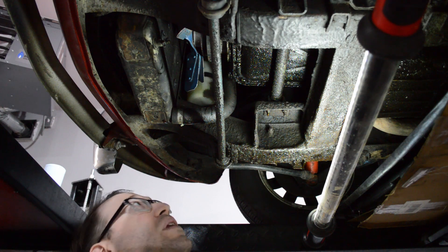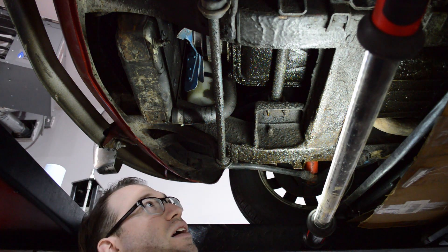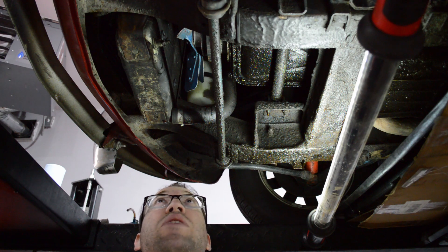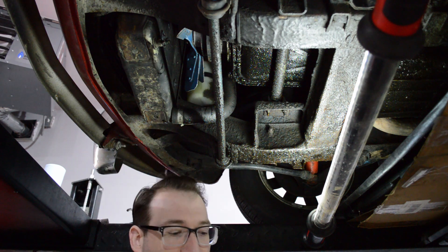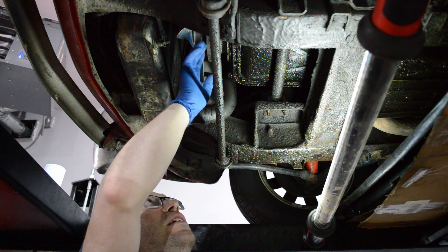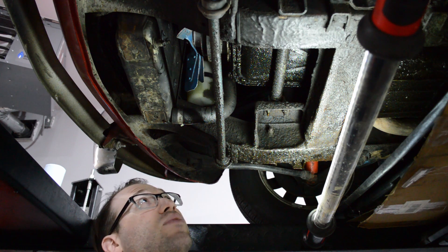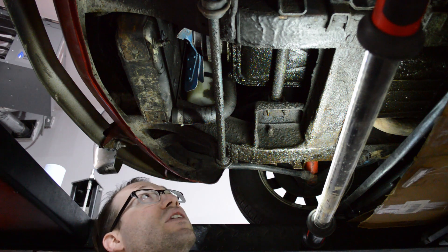It is a bit of a mess down here — there's a lot of oil. This engine is going to end up coming out anyway, but not until I have to. I've got other projects going so I kind of want to just keep this on the road for now. Anyway, while I'm draining the coolant and getting to work on the bottom hose, anytime you're down here on these Triumph engines, you want to check crankshaft end float. You want to check this pulley and see the back and forth motion on it — basically looking for how much play it has in either direction. The way to do that is to set up a dial indicator, which I shall do now.